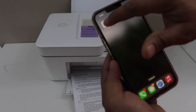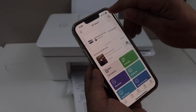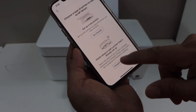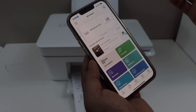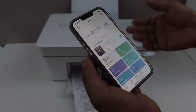If you don't have this app you can download it from the app store. In the app, click on the printer icon on the top, click on the second option 'Complete Setup.' Select HP DeskJet 4200 series and it will instantly add the printer so we can start using it for wireless printing and scanning.